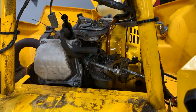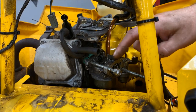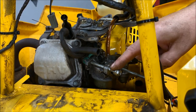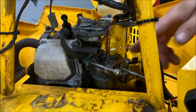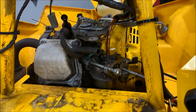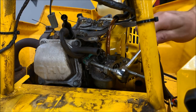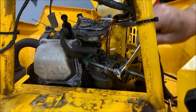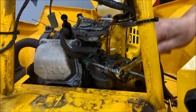Right, so in case you didn't understand what I was talking about as far as double nutting the studs, we've taken the two nuts and we put them on the stud back to back, or flange to flange. We've tightened them down, and what we're gonna do is we're just gonna use those to break the torque on the stud. And all we're gonna do is just back that out.